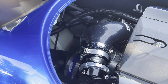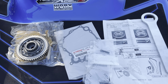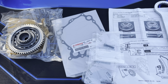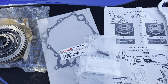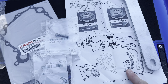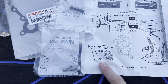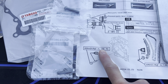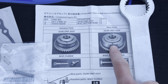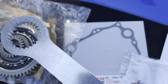So I'm going to go ahead and dig into this thing and take you step by step on how to replace one. First order of business is getting the blow-off valve removed, but before I do that I want to show you what came in this kit. It comes with a couple of new bolts to tighten down your timing tensioner — obviously use Loctite on those. It gives you the foot-pound rating for all the bolts. This is what the new clutch looks like, and this is the old one. And this is the tool you're supposed to use to hold it when you're tightening or loosening it.